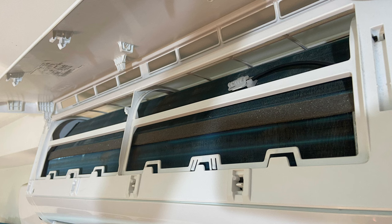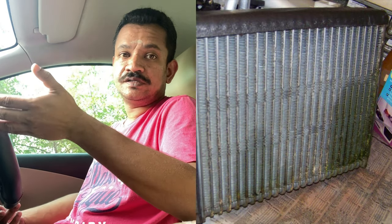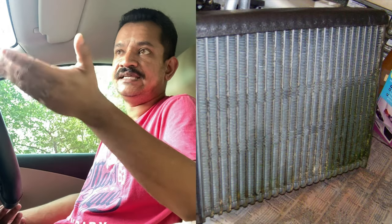In today's video I'm going to show you how to clean the evaporator or the cooling coil of your car's HVAC system. The evaporator unit located inside your cabin, much like the one inside your home split AC, is very prone to dust and dirt accumulation. Over time, if it is not cleaned, your HVAC system becomes ineffective, chilling is affected, and sometimes bacteria or mold settles on it, resulting in a very stinky odor inside your cabin.